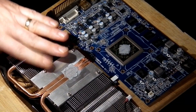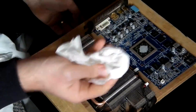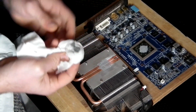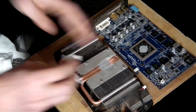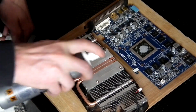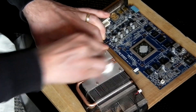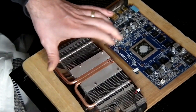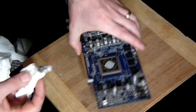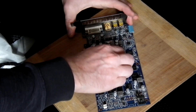So we need to clean this. Clean the card, reflow the chip, and hopefully it will be working again. Don't be scared. Use any paper towel for cleaning this old thermal compound. Look at how dry it is - it is like one piece. Just clean that. I use isopropyl every time - clean alcohol for cleaning stuff like this, it is so helpful. Also you will need to clean the dust from here, but do it at the end. First of all, always clean the old thermal paste.